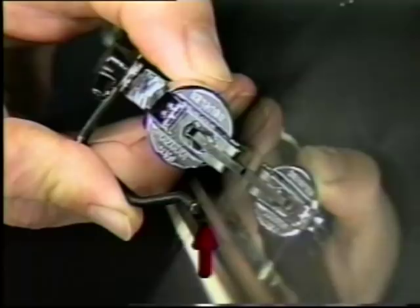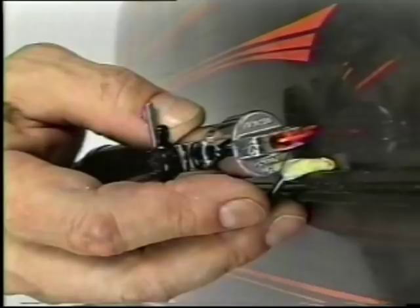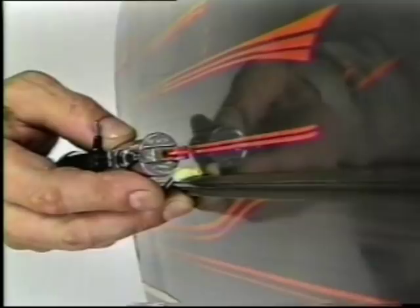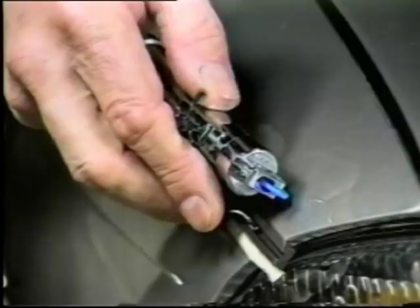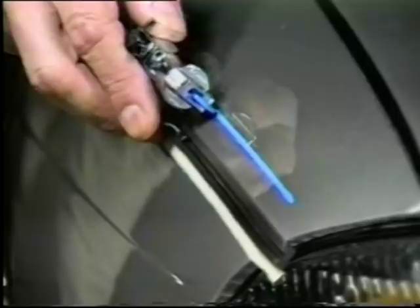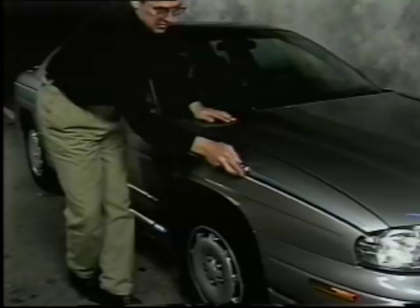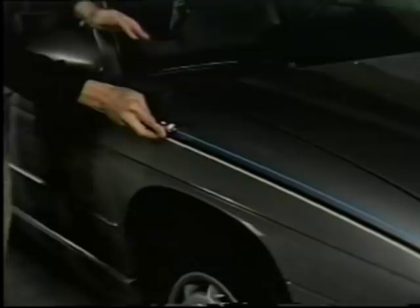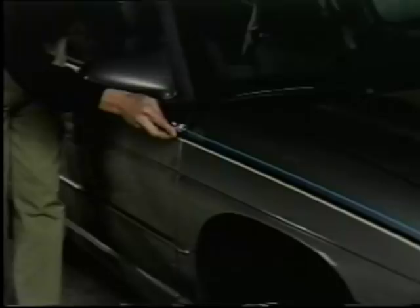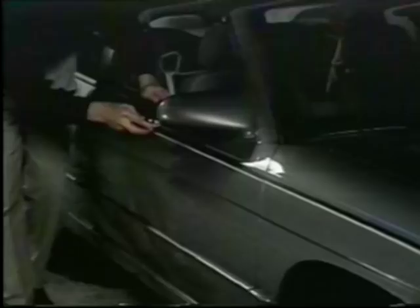When using the edge rather than the track of the magnetic guide, it's a good idea to use your finger under the edge opposite the guide arm to prevent the magnetic guide from moving. If the guide arm comes in contact with the car's surface, wrap it with tape. Some painters prefer the guide arm on the opposite side of the magnetic guide. Before striping, get into a position where you can see the wheel making contact with the surface of the car. Begin striping by placing the guide arm in position on the magnetic guide and the wheel flat onto the car's surface. Keep your arm extended in front of you to keep the tool parallel to the magnetic guide. Use your other hand to keep your balance. As you move from front to back, smoothly walk backward in a continuous motion with a toe-heel step, one foot behind the other. Do not shuffle and keep your painting arm extended. With very little effort, you'll be striping with professional results.